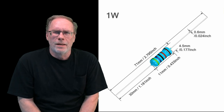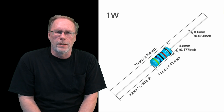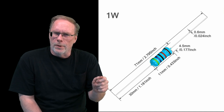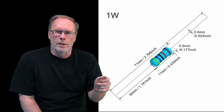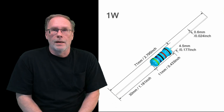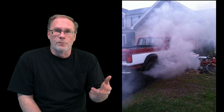The resistor is about $1.80 plus shipping. Where you took the positive off of the solenoid or relay, whichever you want to call it, where that positive cable came off, you would just install a wire along with the resistor and hook it to ground, and that'll tell the computer that everything's cool and you're not going to be throwing any ghost codes or causing any other type of runability issues. With that, we'll move on to the quick tutorial. Hope you enjoy that.